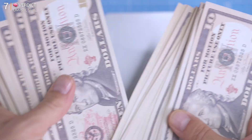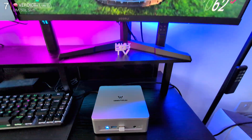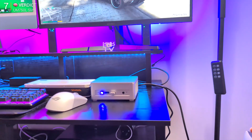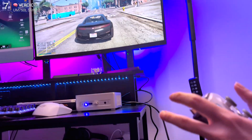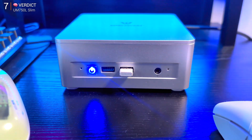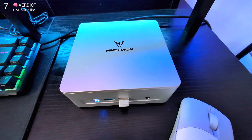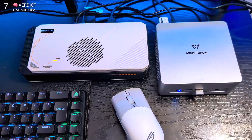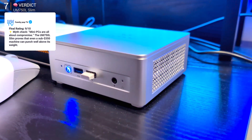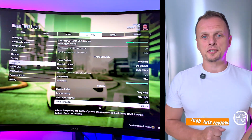So the UM750L Slim is honestly the cheapest mini PC I've seen on Amazon with USB4, which means you can plug in an eGPU and suddenly have a proper gaming machine. Out of the box the integrated GPU handles almost everything at a basic level, and the rest of the system — Ryzen 5 7545U, dual PCIe Gen 4 slots, 2.5G Ethernet, and USB4 — is solid for productivity, streaming, and light creative work. Sure the RAM is soldered and the chassis isn't the easiest to open, but for a budget-focused entry-level mini PC these are small compromises. Compact, upgradeable, wallet-friendly, and with an eGPU it's an absolute little monster. Drop your hot takes in the comments, and don't forget to subscribe.